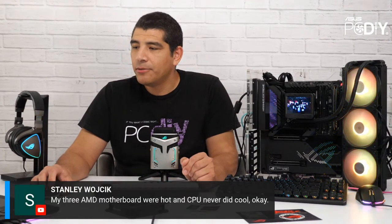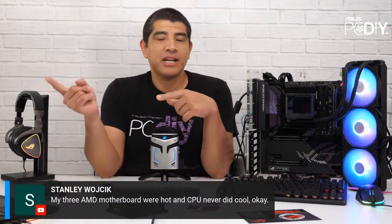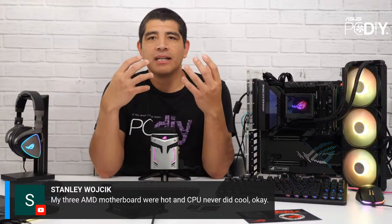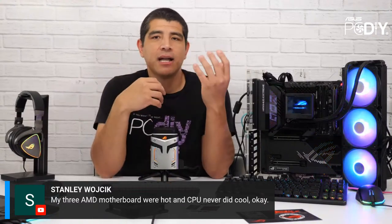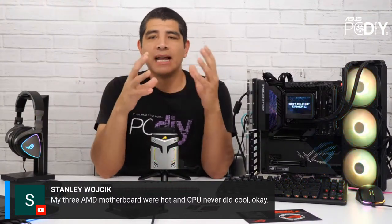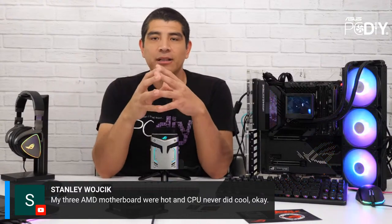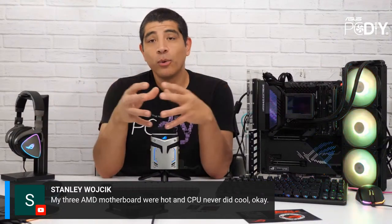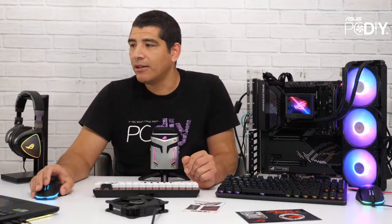So Stanley, you make an interesting point here. So my three AMD motherboards were hot. You have to keep in mind, these are actually using mobile CPU parts. They're not using desktop CPU parts. So the wattage and the power envelope considerations are very different, right? On a desktop, you're sometimes talking about 4 to 5 times more power that the CPU is using compared to what you might be offering here. But here, there's a nice balance of still offering high performance, but in a much lower power envelope, and also quieter operation with lower power consumption. That's a really big difference in terms of how these units have been set up and designed.